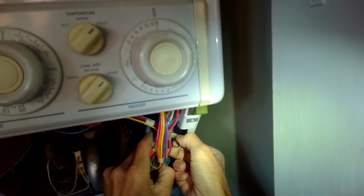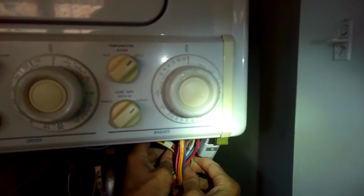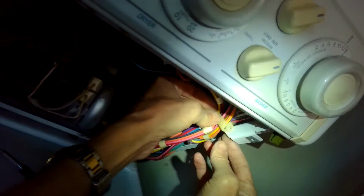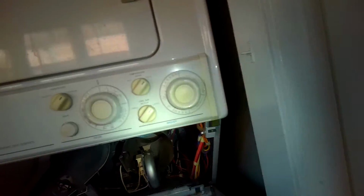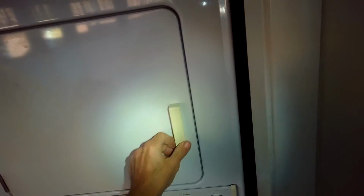Yeah, so the rumbling stopped. Sounds much better. So this is the little thing that's holding the wire harness. We'll put that in position and add the screw to it. And then here's the access panel, goes back on. Put the bottom position in first and then hinge it up and then add the 2 Phillips head screws. Right, give it another test. Yeah, that's good. So right when you open the door, that rumbling should stop.